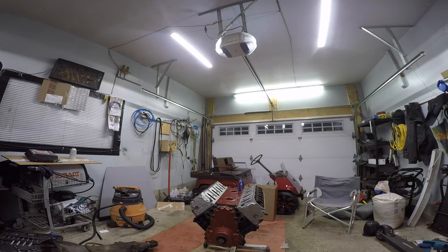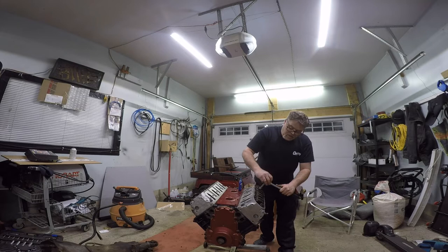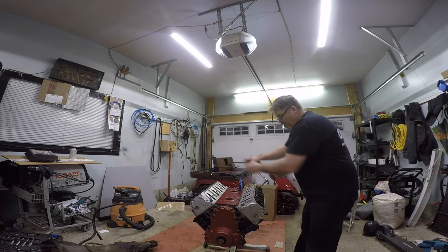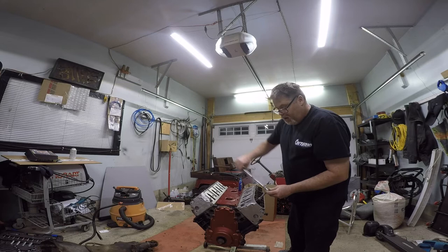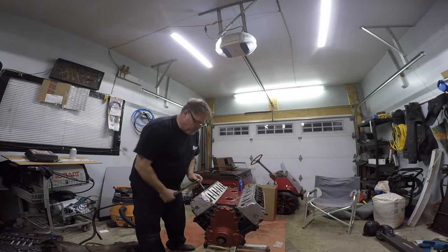When you're doing this, I would suggest making sure the rocker is in the middle. The ones that are like this are where you're collapsing the spring and opening the valve — that's why they say you can normally just torque them all to 22 and you're good to go. But I'm still going to rotate the engine and do it again, that makes me feel better. This one's closing the valve, this one's opening the valve. 22, 22, 22. There we go.